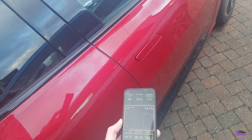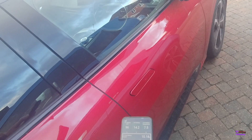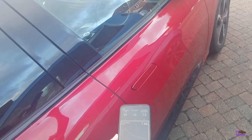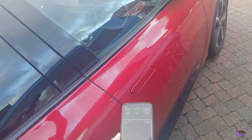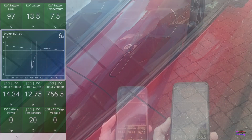I'm going to leave this for 10 minutes and see if it creeps up the state of charge. Oh, it's gone up now — so I think you can say that just turning the car on remotely is charging the 12 volt. If I wait long enough it should go to 98%. I just turned the car off.